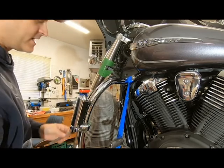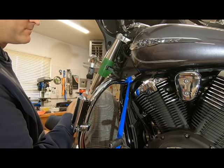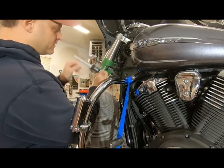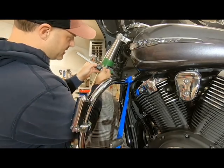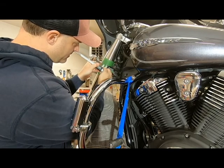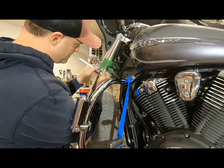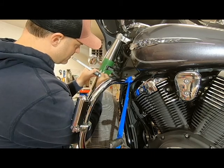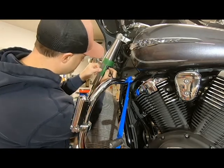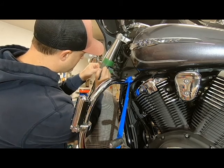And to do the other side, I calculated it out and did a little bit of measuring on the other side. You need to set your measuring device or your calipers to 1 centimeter. Calipers work good because this allows us to basically scribe a line on the tape, and then we can just fill it in with our marker after the fact, just like so. There we have it. And to fill it in so I can see it better, we're just going to line up our straight edge and draw a line.